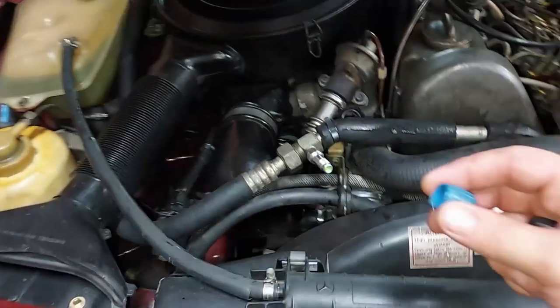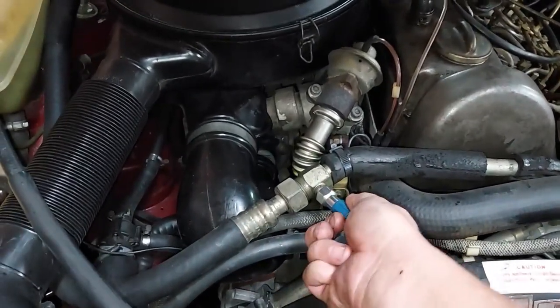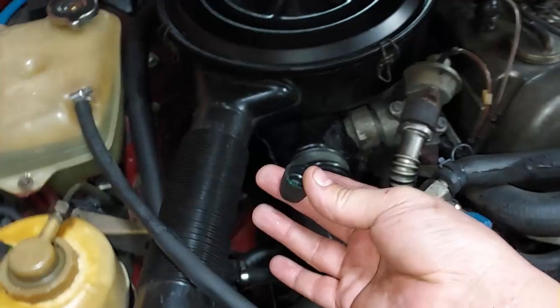I'm going to get the car up in the air and get my black light to check around for any leaks, because we put in some UV dye — the green dye — and it shows up under a black light. Mission accomplished; we'll check for leaks to make sure everything looks good. I just need to put our low-pressure fitting back on and then go under the car and put our high-pressure fitting back on.